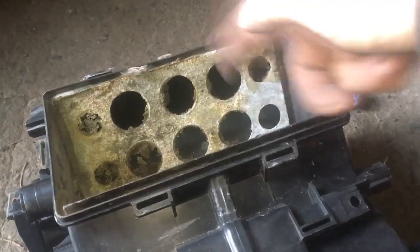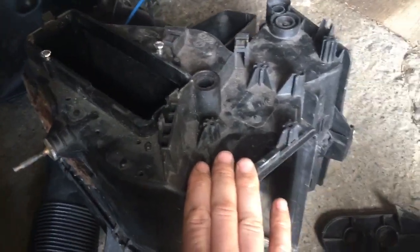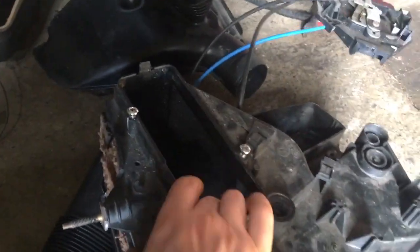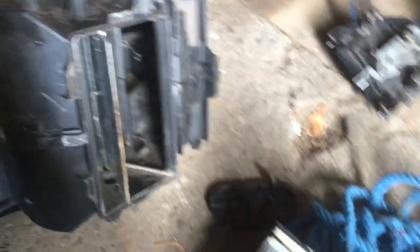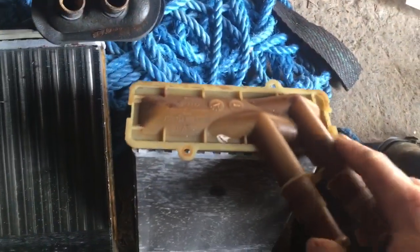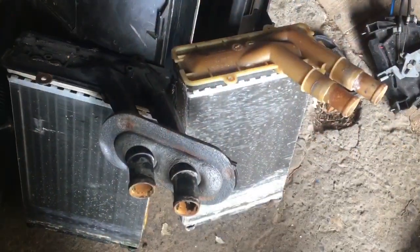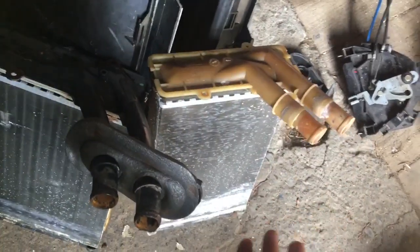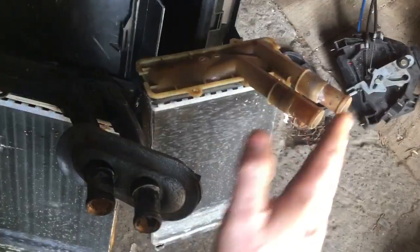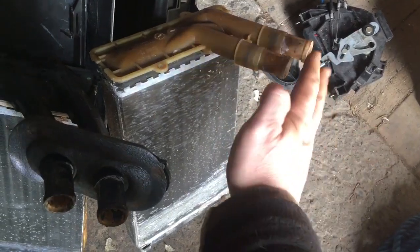This HVAC is from a right-hand drive — I think it's from a Corrado, that's what I was told when I bought it, but it's 50/50 whether it's a Corrado or a Mark II Golf. It came with no heater matrix. This one here is from the left-hand drive Corrado — it fits, but the pipes are different. This one's from a Passat, and if I compare the two pipes, the major difference is there's a kind of bend in these and the other ones come out straight. When it's back in the Corrado, these stick out more and the metal is kind of cutting off, so you can still get a pipe onto it — it's just slightly more impractical.